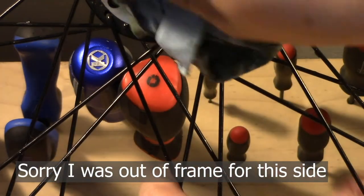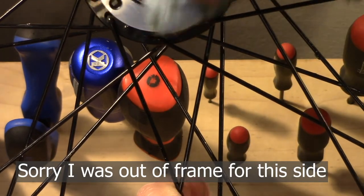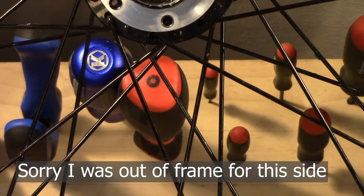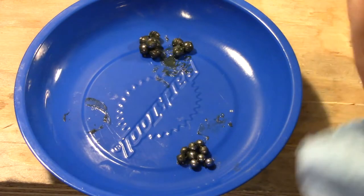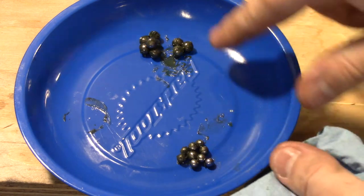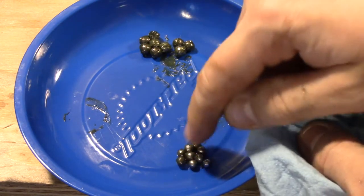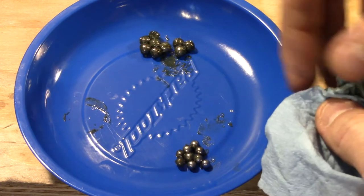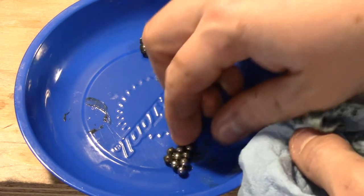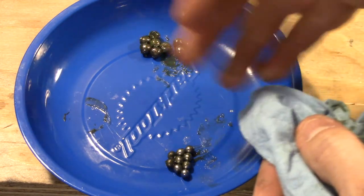Just going to clean this out. We need to clean as much of this grease out as we can get to. It looks like this grease is still pretty fresh, but we want to make sure we get all of it out because there could be little metal shavings or contaminants in there — we don't want that marring up any of our parts. Also, on this side here, we have a little seal. All we need to do is gently pull that out with a pick or a screwdriver. So it looks like we have two different size ball bearings on this wheel: nine of the smaller size and nine of the larger size. The larger size came out of the braking side, and the smaller ones came out of the drive side — probably two different sizes because you need a little bit more space for the freewheel on the drive side. We just want to make sure we keep the drive side parts separate from the non-drive side parts.